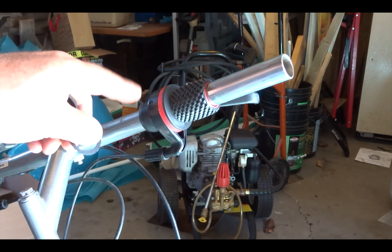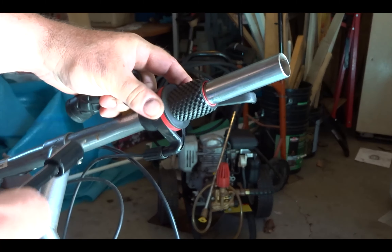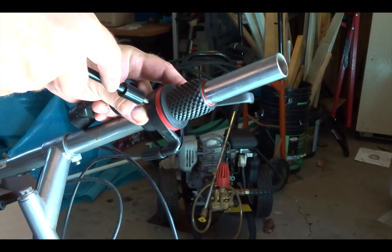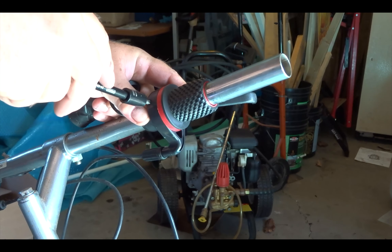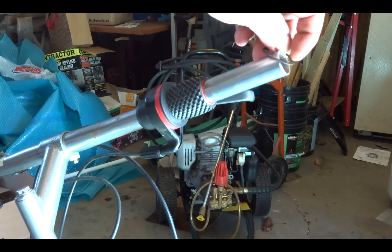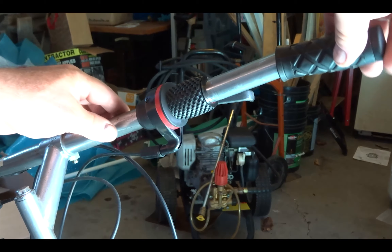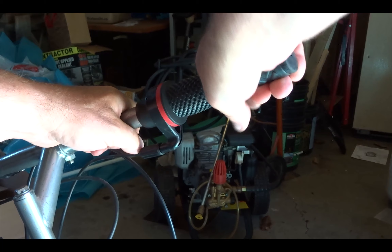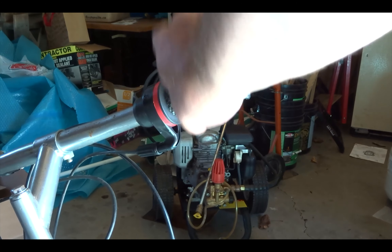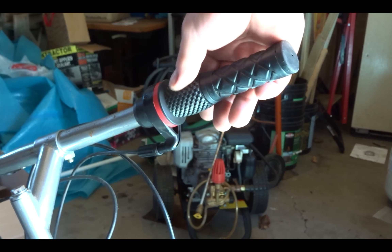This is all hooked up — the grips are on and it turns out that's a Phillips screw. It looks similar to the other side, so I'm going to give this a good tighten to hold the whole thing in place. That's as tight as I could make that. And remember the little washer thing — put that on, find the smooth side, and slide that there. I'm going to put my old grip back on. Make sure it's turned so that all the cable is out — that way when we adjust it, it will pull in that derailleur and change the gears.